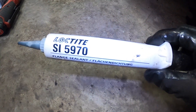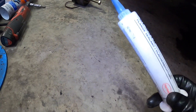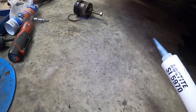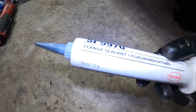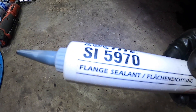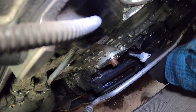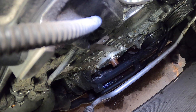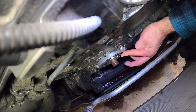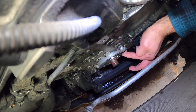To finish up the complete installation, you need Loctite 5970 — it comes in a syringe and you squeeze it just like a syringe to get the RTV out and push it into those two little sections, those two little nubs in between the two aluminum blocks. I'm finding that actually putting it on your finger and squeezing it in that way might actually be the most effective method.